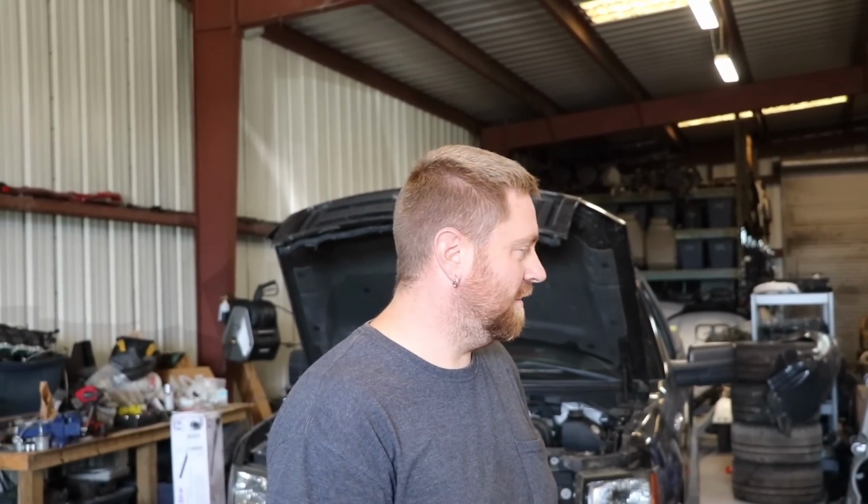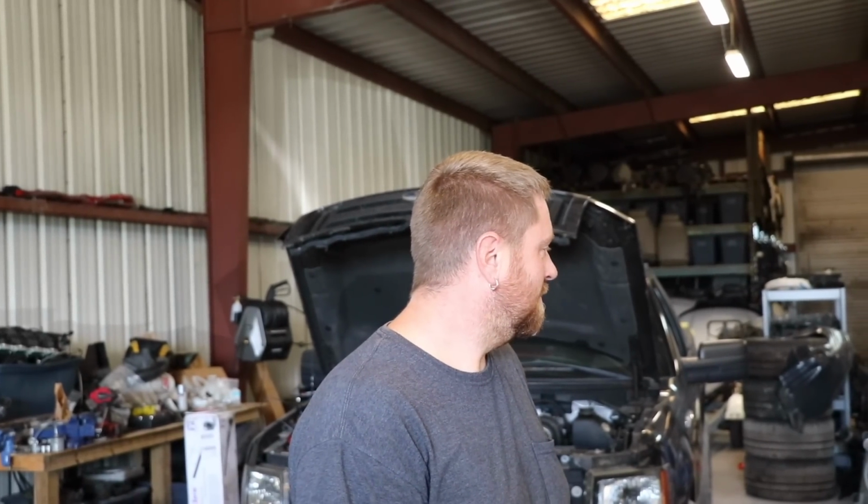I'm speechless. I'm super excited, super happy. Just a few little things here and there. I guess I miswired something, so the PCM, ECM, ECU, whatever you want to call it, actually has constant power. Because of that, my fuel pumps are running because they're off the trigger on that. So we'll just have to rewire that, come back with all of the hoses and set up power steering, bleed the brakes, fill the transmission, weld the exhaust. Woo! Oh no, is there anything else I'm missing? That's it.